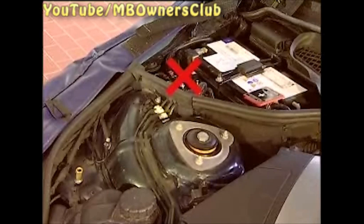There is a specific feature with jump-starting. The plus terminal is not suitable for the jump-start, because the terminal does not have enough contact pressure. Under certain circumstances, a drop in voltage can result from a jump-start. Therefore, connect the clamp directly to the positive terminal of the battery. Attach the negative clamp as before to the ground bolt.